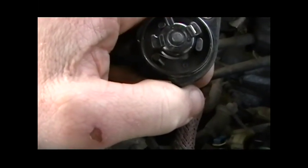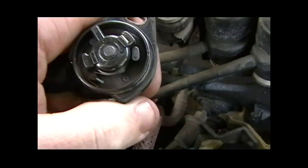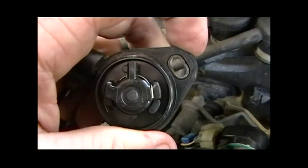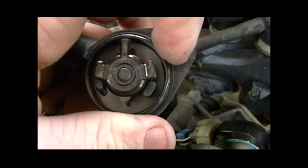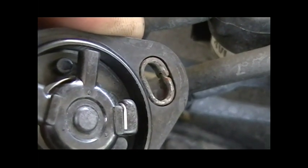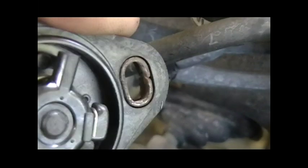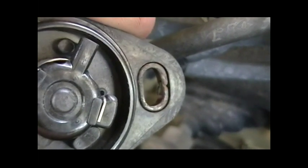Take your chisel in a direction away from the aluminum engine block — aluminum is soft — and hit it slowly and carefully. Eventually you get rid of the plastic, and what you're left with is this metal ring that surrounds the screw. It still functions as a spacer and makes the screw difficult to manipulate. Tap that device around until you can see and access the notch. At that notch, take your chisel and spread the two pieces apart until the metal ring comes off the screw. You can then grab the screw with pliers and lefty-loosey, take the screw off.